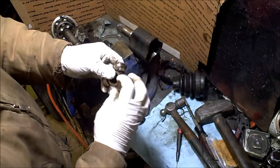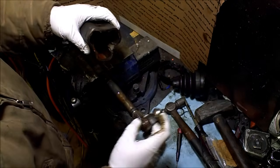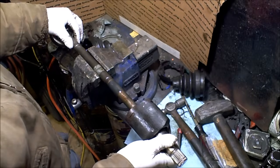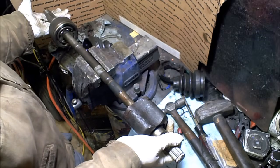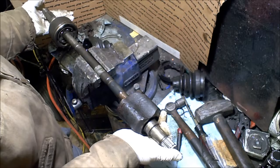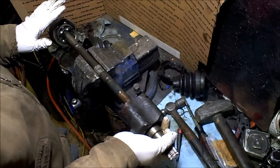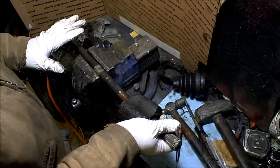And these are just rollerball bearings, and this just sits in here and slides. What it allows on this side is a little bit of an angle, but more or less allows it to travel in and out. Because as the wheel goes up and down — as it goes down, this drive shaft has to lengthen a little bit, and as the wheel comes up to center it's a little bit shorter. So this is constantly moving in and out just a little bit, and it also operates at a slight angle.